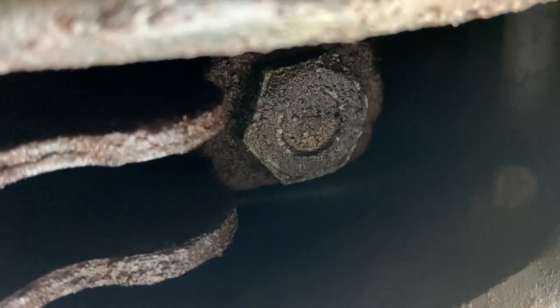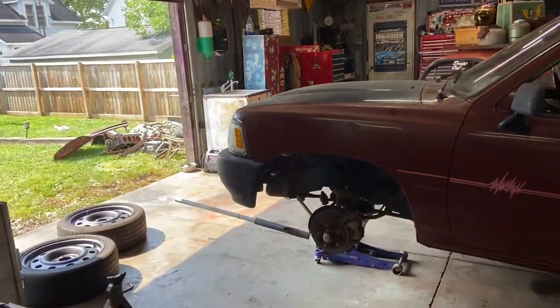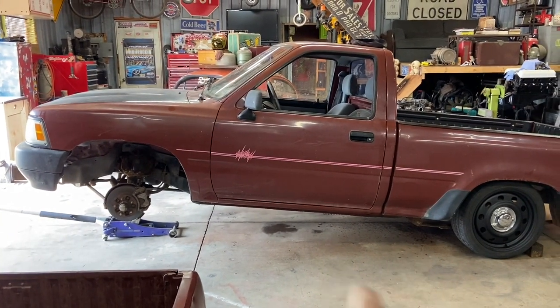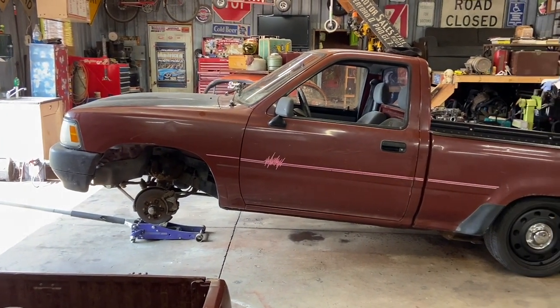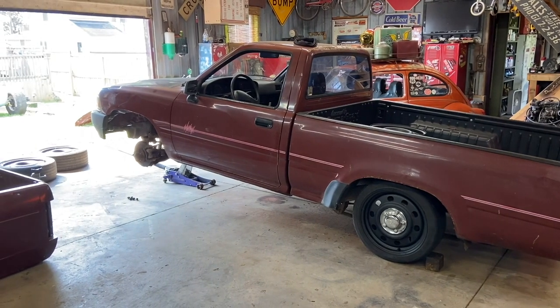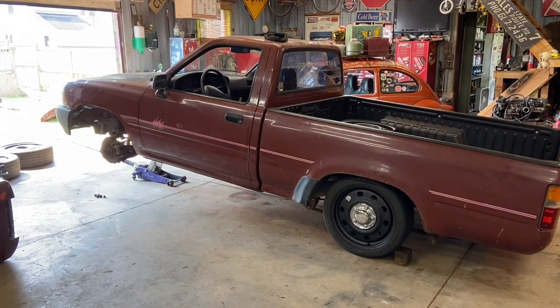You just get on that bolt there — I think they're 23 or 24 millimeter on a Toyota — and you'll have to get a wrench on those top nuts. You just start spinning them loose and don't get too crazy with it. I'm going to mount these wheels up on the front so I can let this off the jack a few times as I'm turning them bars down, so I can kind of match the rear. I should be able to get a four or five inch drop out of just twisting those torsion bars — and like I said, it's completely free. So we're going to have like 50 bucks in dropping this truck.